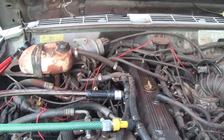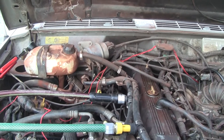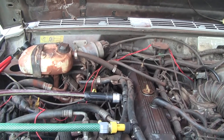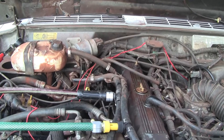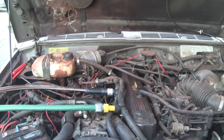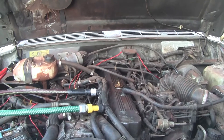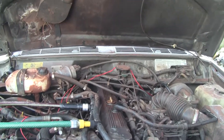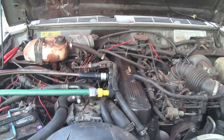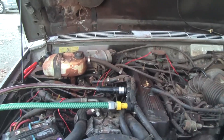We're 84 miles round-trip from the nearest auto parts store, so I had three bottles of recycled — I call it waste antifreeze. It's still useful but it was in something else for a while. I put that in here, and now instead of being good for a 208-degree boiling point, it's good for 255 according to my hydrometer. It could be as good as 285 if I had fresh 50/50 antifreeze.